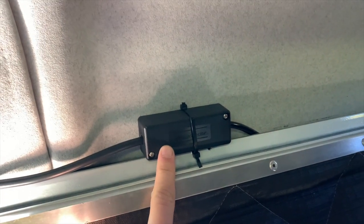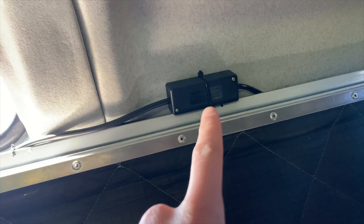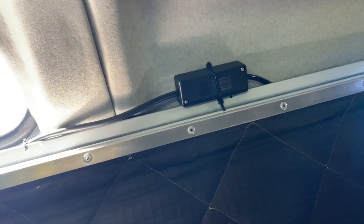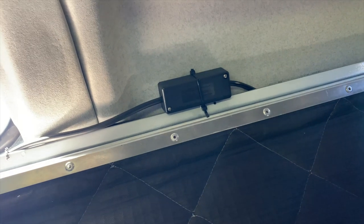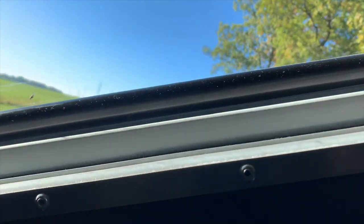Okay, so if I get into the car, what you'll see is that it's coming through here and going around into the cell protection. So what this protection does is, if the solar panel gets too warm, then this little box here will decide to stop the solar panel functioning so it doesn't overheat. So it's sort of an overheat protector. Now the cable runs along the window seal, and it goes back out into the ceiling of the car, around, up, and down.